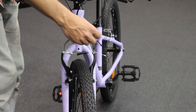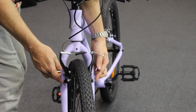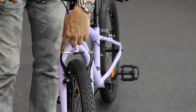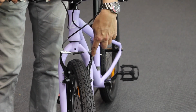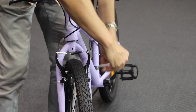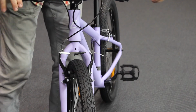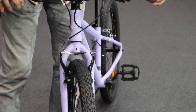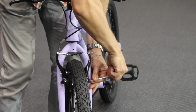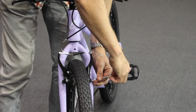You've got an adjustment on either arm, the tension adjustment, which you can see here and here. When I pull this lever on this one, this arm is moving much more than this arm. So we need to add some tension to the spring on this arm. So we're going to turn this bolt inwards. Test again. Now it's much more even. Probably needs a bit more. Turn it in a little more. Let's have a look. Now we're nearly even, still a little more.